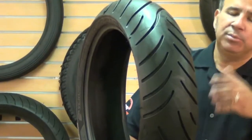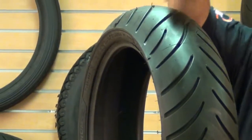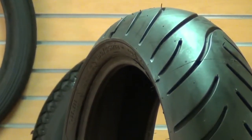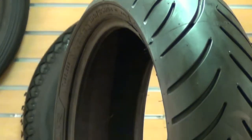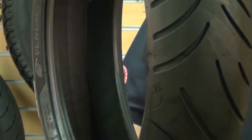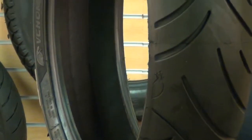It has a very unique tread element that pulls moisture away from the contact patch, and a very unique splice down the center through this tread. What that does is it breaks up some of the harmonic that some tires can pick up. Most modern V-twin custom cruiser guys never talk about sound or noise, but this tire can make noise — since it has this intermittent block, it tends to break up some of that noise.